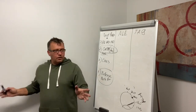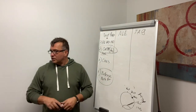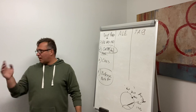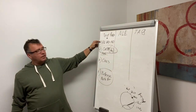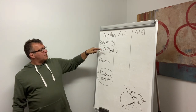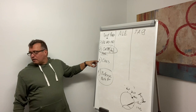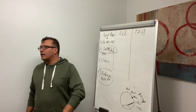Stop. Oh, I forgot to release the brakes. I'm going to start my brake test over again. Don't ask, just do it. How do we start over? Make sure you pull the brakes, build up pressure, start up the engine, build up pressure, cut off, put it in accessory, make sure the ABS light came on and went off. Make sure the chocks are placed, release both brakes.